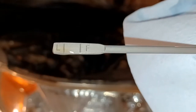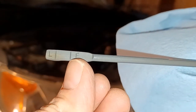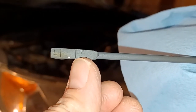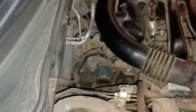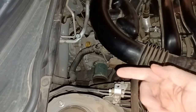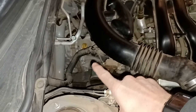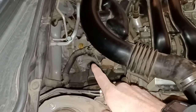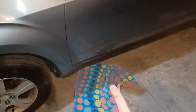When I took mine out it was right just below the full line, which is exactly where it should be — somewhere in between those marks. Replace the dipstick, then take the vehicle around the block or wherever you want to go, and come back. Make sure the differential is nice and hot so when you open the drain plug it gets all the oil and contaminants out of there.